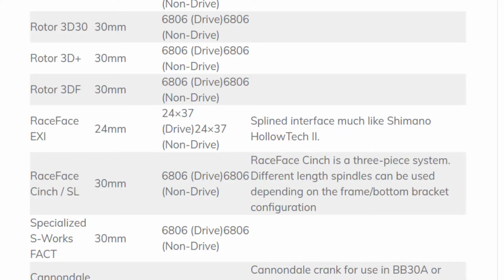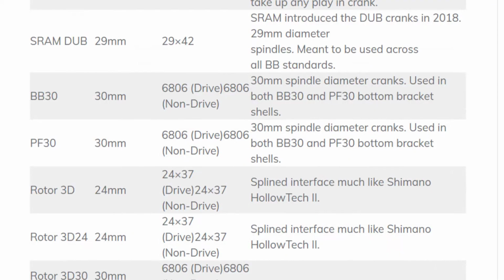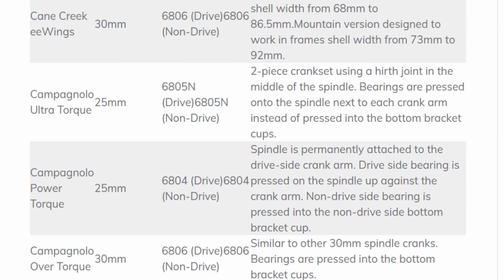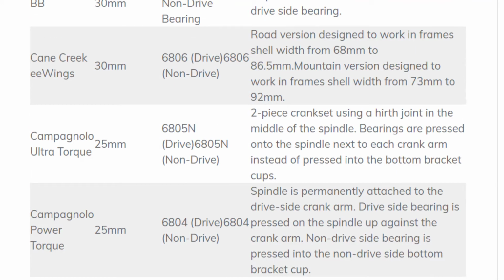That being said, there are pretty much just two factors you need to be aware of when buying a bottom bracket: the type of bottom bracket your frame is designed to take, and the crank set that you want to use. Make sure you get a bottom bracket that goes with your crank. Different manufacturers couldn't agree on which bottom bracket spindle setup was best, so there are so many different types. I'll have a link in the description to my site to show you just how many different types of bottom brackets there are. Basic rule of thumb is if you get a Shimano crankset, get a Shimano bottom bracket. If you get a SRAM bottom bracket, get a SRAM crankset.